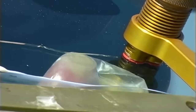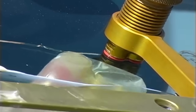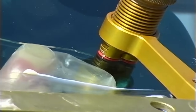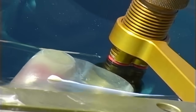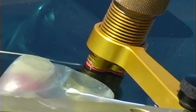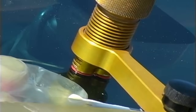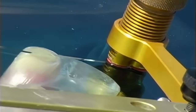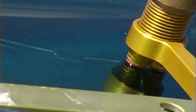Go down to the crack and back up a little bit so you can see the resin going in. It's just the first two or three inches that are going to be tight — that depends a lot on the crack. The trick is to flex the crack open just enough that the resin goes in, but not flex it too hard and cause the crack to spread past your stop point. If it does spread, you just have to go out and put another stop on the crack.